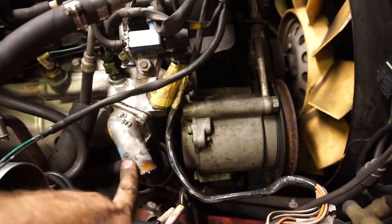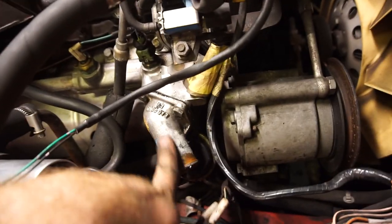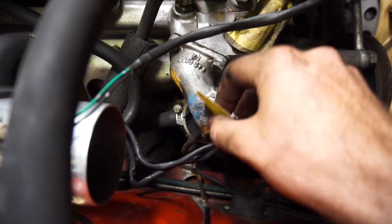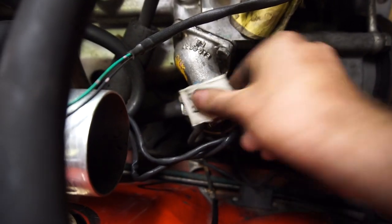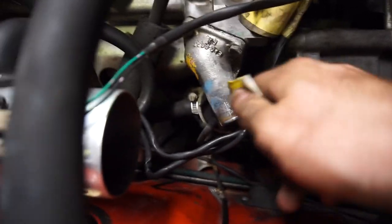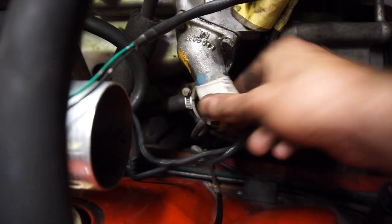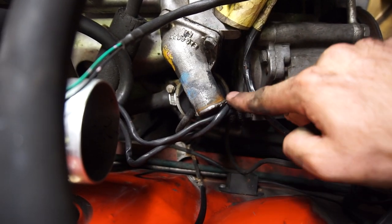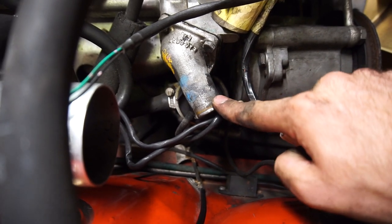The other important thing when fitting hoses back, especially on an aluminum block like this, is to clean all the connection surfaces. I've already cleaned the radiator fitting a little bit. All I do is take some 400-grit sandpaper and move it back and forth to get a nice clean surface with no pitting, so the hose will seal nicely with the hose clamp. If it's really badly pitted you could go down to 100-grit.